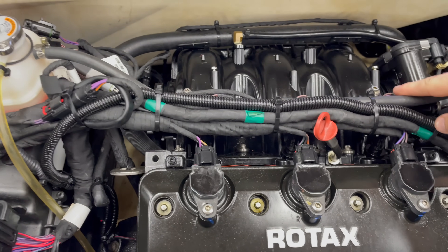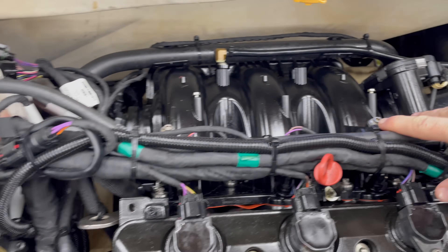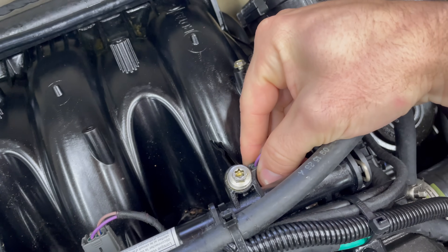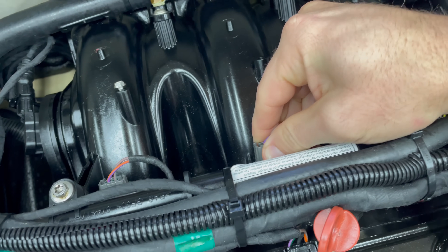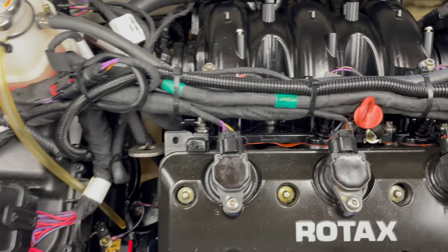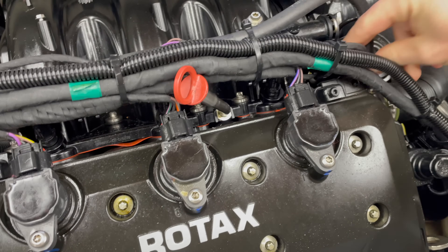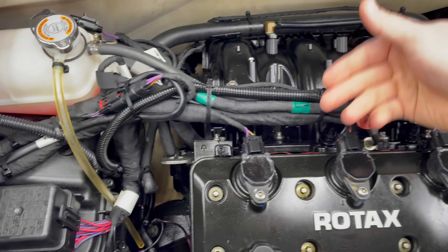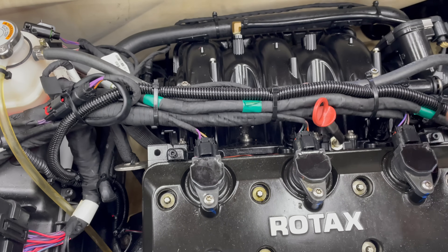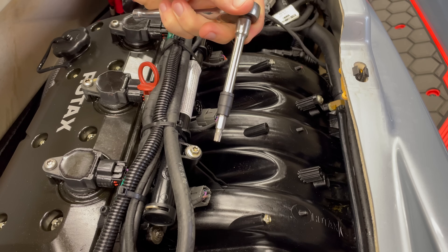First thing I'm going to do is we're not going to have to move too many things out of the way, but I do need to remove the two bolts holding the fuel rail in and remove the fuel injector clips — these guys here. So I'll pull that clip, this one, and this one, and I'm going to stage the camera to remove the fuel rail. We don't need to remove anything else. Just like a lot of other things, this fuel rail on the 325 is secured with a T30 bolt.